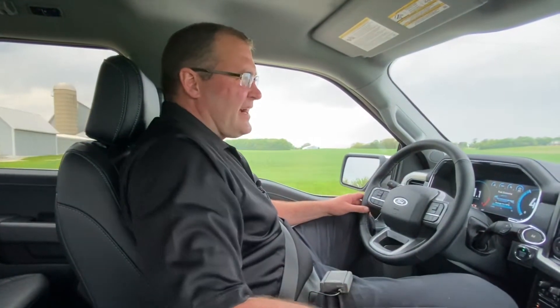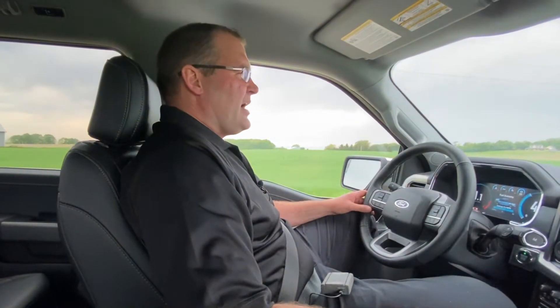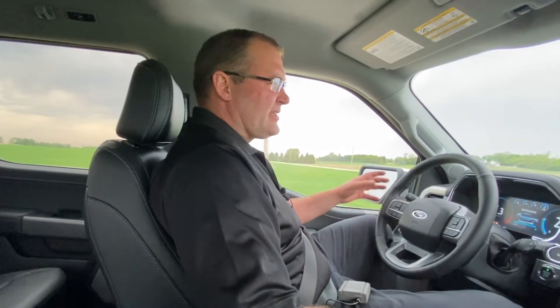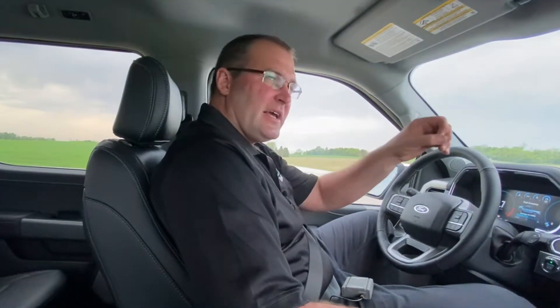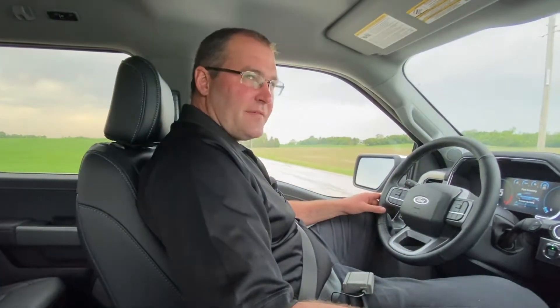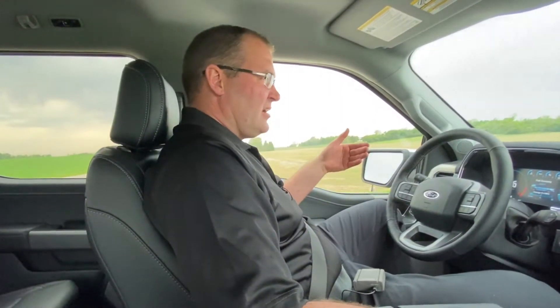So I learned this fact accidentally. I watched a YouTube video — I don't even remember the creator — but he talked about how all you've got to do to get rid of cylinder deactivation on a Ford F-150 is go up by the battery and take one of the little wires off the battery, and that's supposed to deactivate the electronic battery system monitoring and kill the cylinder deactivation. Well, I thought that was awesome — except it doesn't work.